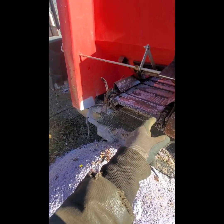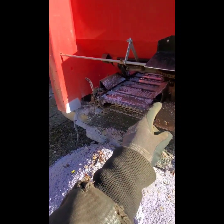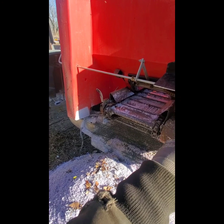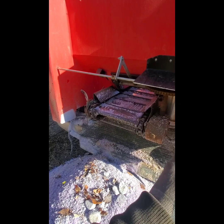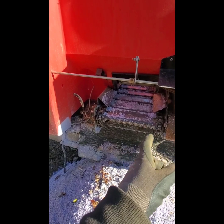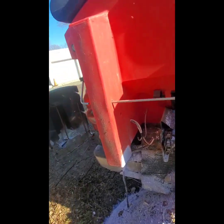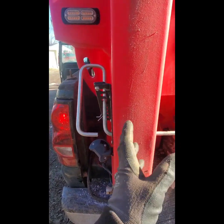On this one, the chain right here was frozen solid. We ended up saving the chain - we bought a new one, but the teeth gap was off and we couldn't put it together. So we saved the old chain and literally had to break each link, spray it, break the next link, spray it, and go all the way around the whole conveyor. But here's the issue: they sold us both of them - one we got with the controls, the module, the shaker, the vibrator.